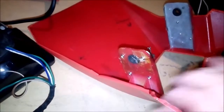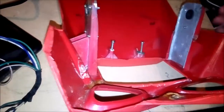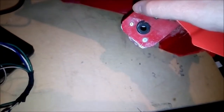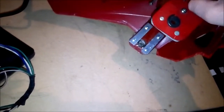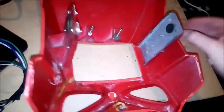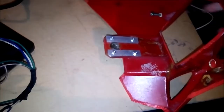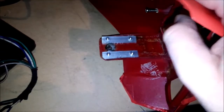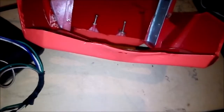It's just to reinforce there — I glassed it a little bit on the outside as well. You can see that someone's tried to do the same with a bit of sheet metal on this side at one point. There's a big crack that ran through there — you can see it's gone twice at some point, got another one along there. Someone obviously riveted a sheet in there. That's done the same thing with the glassing and those two aluminium strips — just to reinforce it so it doesn't break off, shear off, and end up dangling by the wires on the road.